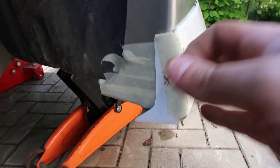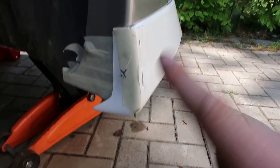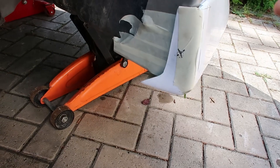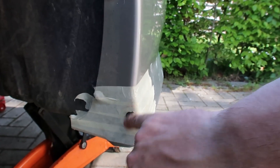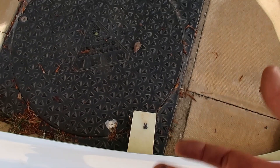What I'm going to do is push this up into where I want it, mark that out, drill these up, and then go in underneath where the under tray would be and mark the holes on those bottom lips so we have a nut set placed in there. It's a much more temporary fit than a rivnut where you can just literally pop it in place. This is all plastic so nothing needs sealing up. We've got our markings on the bits we're going to drill — we'll drill them to the furthest front point so we get a nice tight fit and it pushes it back in place.